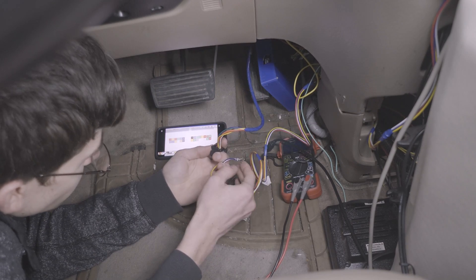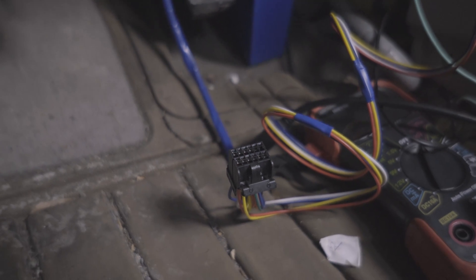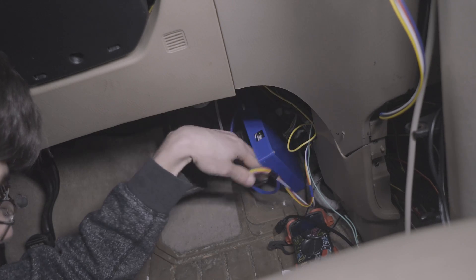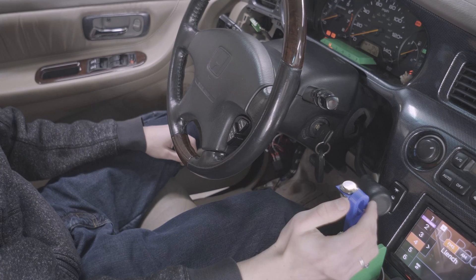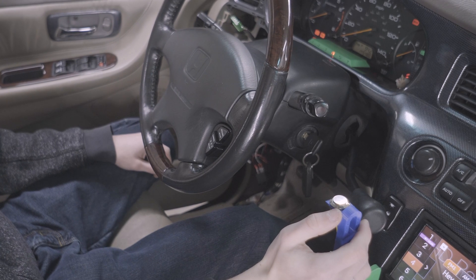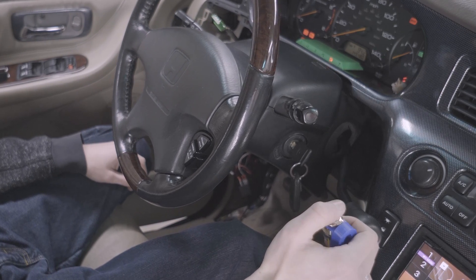Hopefully I don't start fidgeting with it on the road. As much as I wanted to start the van up and go right into gear, I knew that would be a recipe for disaster. In order to try and spot as many issues as possible before they could cause any damage to the transmission, I decided to do a dry run of sorts. I connected the controller and turned the key to the on position, and I went through all the gears without the engine running. This way I could ensure that the solenoids were functioning as I expected and make sure that my code was also working like it should. And boy, I am glad that I did this. For some reason, my code was hanging whenever I would downshift into second gear. I'm not sure why, but when I added serial debugging to it, it for some reason fixed itself.